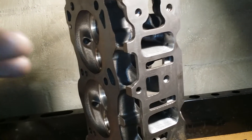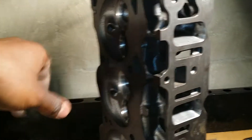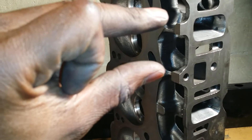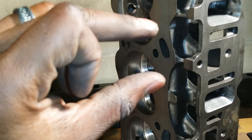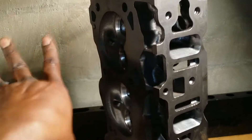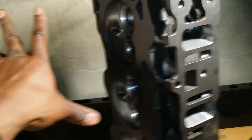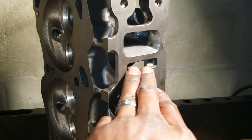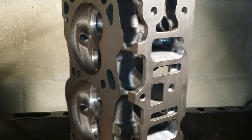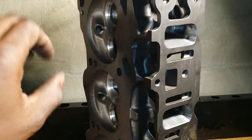I've done it before trying to find the limits of these castings, trying to learn how to port these heads. Anyway, we did a lot of tapering through here. Tapering is when you start out gasket matched and you get a little bit thinner — you want to close that gap just a tad bit all the way through the runner. What that's going to do is make the air shoot into these bowls. So at the end of the runner when it transitions into the bowl, that air is going to shoot out and speed up. I still have to go in and surface tune — polishing, roughing up some areas. I have a formula I've come up with that seems to work best on the flow bench, and it's going to help assist in that tapering and speeding up the air.